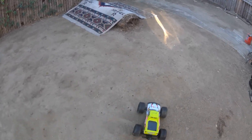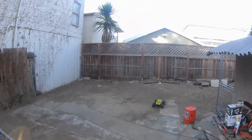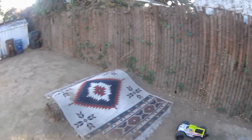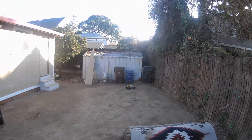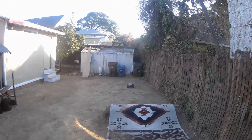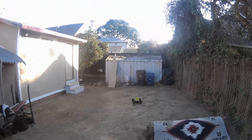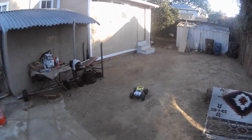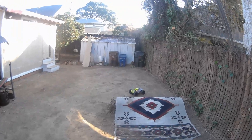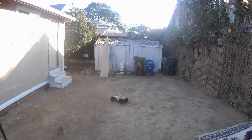These tires are pretty massive for a tenth scale, that's for sure. I've got to adjust these end points somehow because I'm not getting the full pull for sure. And there's a dead spot on this trigger — the neutral zone is set at like 15% or something crazy like that, when it should probably be at like six. I'm just not sure how to program this one yet.